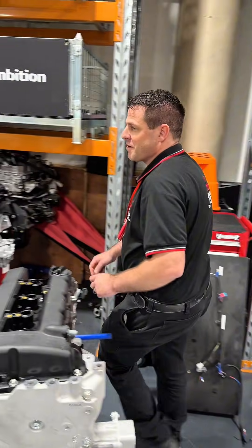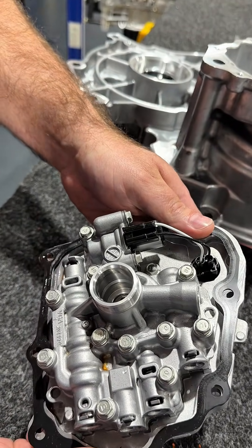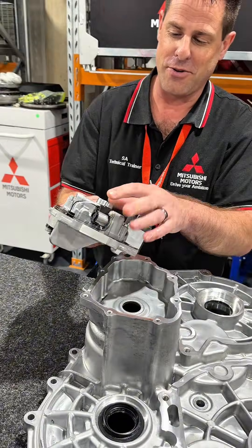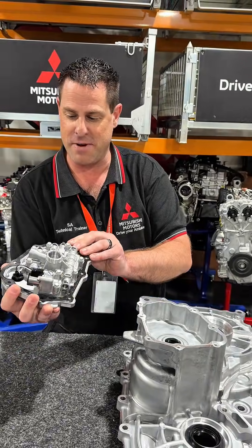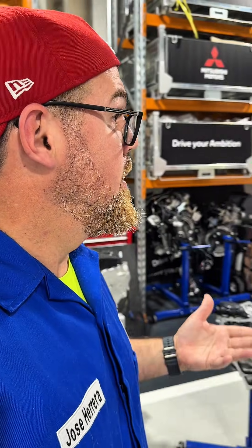What activates the clutch? Over here we have a hydraulic assembly — it's just a simple on-and-off solenoid. There's a pump in there driven by the wheels, so whenever the wheels are rotating the pump generates hydraulic fluid pressure. When we turn on the solenoid, it puts high pressure fluid forcing the clutch plates together on that assembly, allowing torque to transmit between the petrol engine and the wheels. The clutch only engages and disengages at cruising speed, so its use is actually minimal.